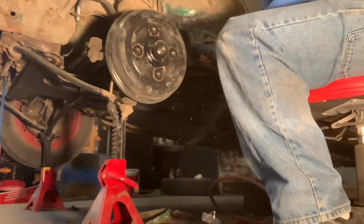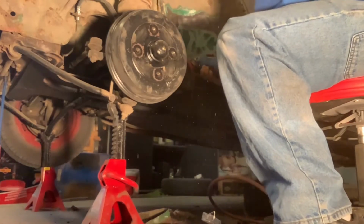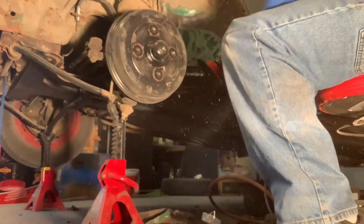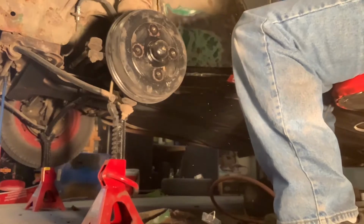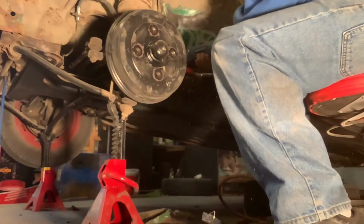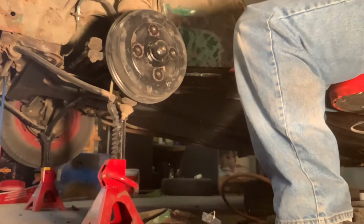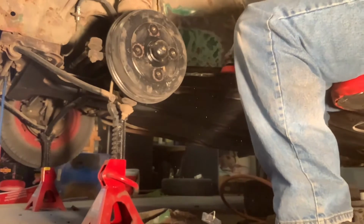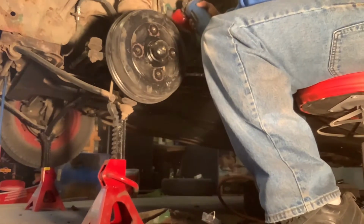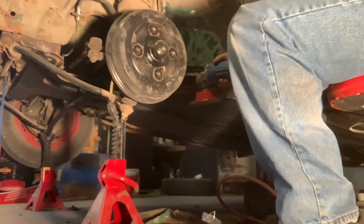And so I cleaned that all up. I was really happy, and I sprayed, I think you'll see here right away, something that's called Weld Through Primer. It does a really good job of stopping rust and any continued deterioration of your metal. And then you can put your patch on. Mine has lots of high levels of zinc, and it conducts electricity, so you can actually weld through it. So that's pretty exciting. It worked amazingly well.